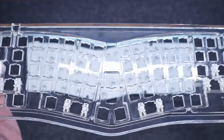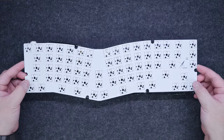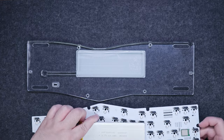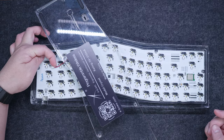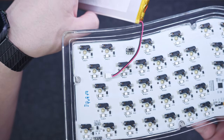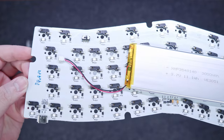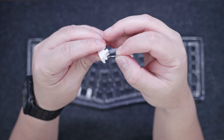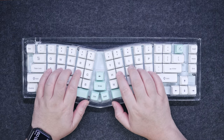Here's a closer look at the stock plate mount stabilizers — barely lubed. We have the PCB, and as you can tell, there's no foam here, and the PCB doesn't support screw-in stabilizers. Under the PCB, we have the 3000mAh battery. I had a hard time removing the battery wire from the PCB since the socket is quite flimsy and feels like it can get damaged very easily, and the plug is really hard to pull out. The hot swap sockets are made by Kailh, and again there's no foam here. Looking closer, the stabilizers actually have some pre-applied lubricant, however it's super faint. Overall, the teardown process is fairly easy except for the battery, and I don't think there's a need for you to open this keyboard at all.